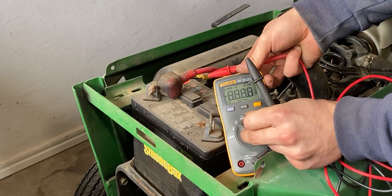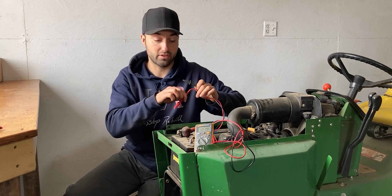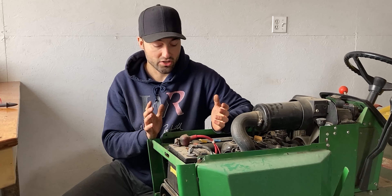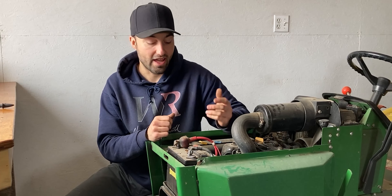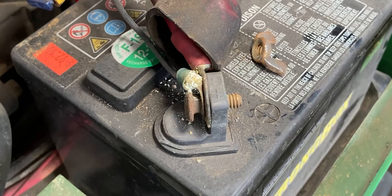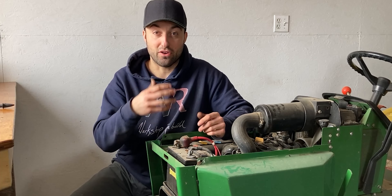Positive to positive and negative to negative — we have a reading of 12.19, or roughly 12.2 volts. That actually measures pretty good; I've seen worse batteries start an engine. So I'm actually leaning towards a cable issue. The negative is ground and the positive goes to the starter, which also powers the dash. Looking at the positive wires there's a little bit of corrosion, and the bolts holding the battery don't seem very good either. I'm going to take this all off, clean up the poles on the battery, and clean up the cables that distribute power throughout this system.